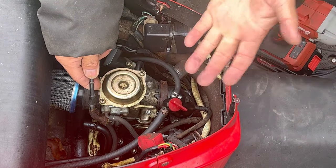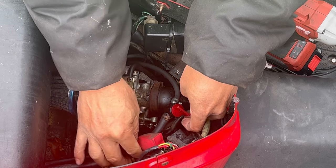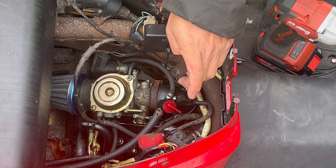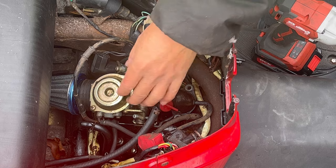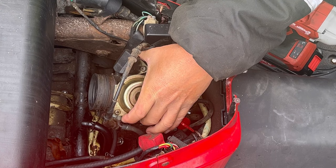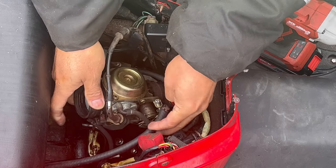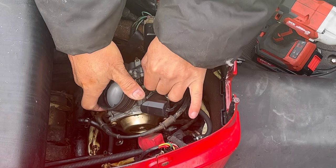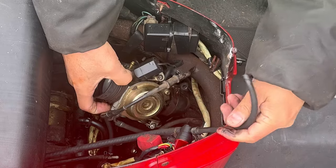I don't understand the whole reasoning behind it. This line over here that goes into a T comes from the valve cover area — also a vent, and there's a pulse to it. Now I'll take out the throttle. The throttle connection is going to be a pain because you have to loosen it. Here's the fuel line — I'm going to take it off now. Since we did the shut-off already, it won't spill out like crazy. There's the fuel line, we'll let it hang.